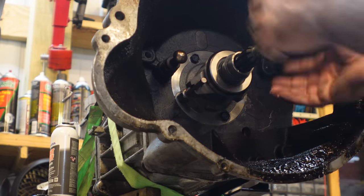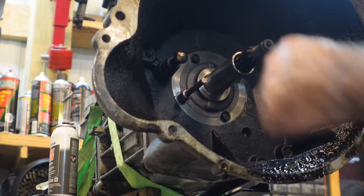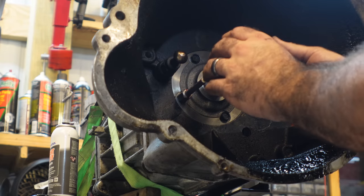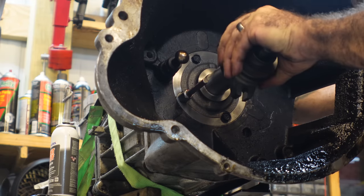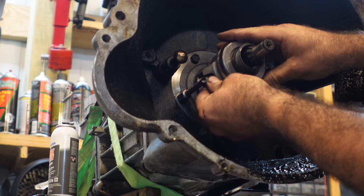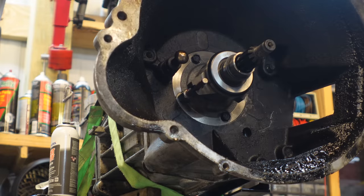As you can see, we have our new retainer on. There's four bolts here, and you're just going to replace one of those bolts with the stud that comes in the package, and that's just so that this can ride back and forth on there, okay? That's all you're going to do. Okay, and then you just line this up on the stud, slide it back. All right, so we need this to be all the way back.